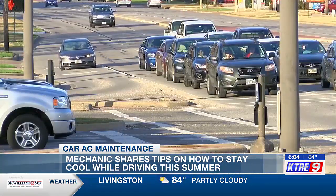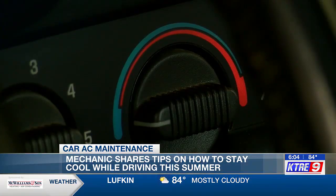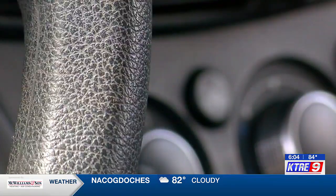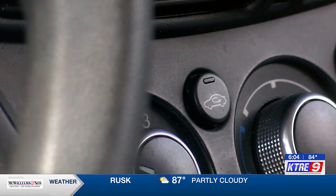When driving, your car's A.C. pulls in hot air from outside and tries to cool it down. But this button — which Stewart calls the horseshoe — can recirculate the air in your car, keeping you and the air cooled off. The first thing we check when checking A.C. is we make sure that horseshoe button works and that it is going into recirculate mode, because that's critical.